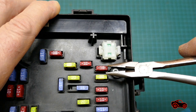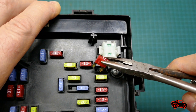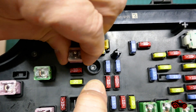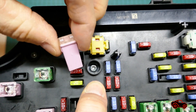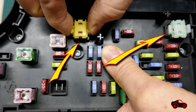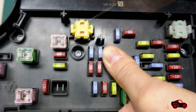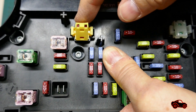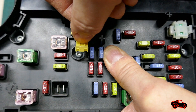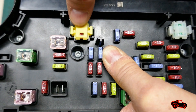The mini-fuses can be removed with two fingers, but it is more efficient to use a fuse puller or needle nose pliers to remove them. The cartridge fuses are bigger and it's easy to remove them with the fingers. There are two fuse carriers to pair some fuses. A fuse carrier can be lifted and the cover unlocked to remove the fuses. The fuses are simply inserted in the carrier, then pressed down in place. Then the cover can be closed and clipped.